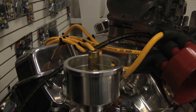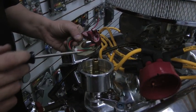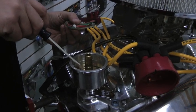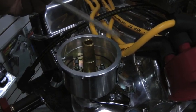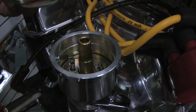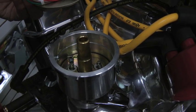Now we're ready to install the electronic module. This is our Unilite module installed to the plate. We're going to drop this into the distributor, making sure it sits on the ledge inside the distributor. The two screws on the side on your flip-up clips will go in here and lock this in place.